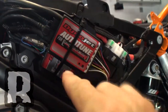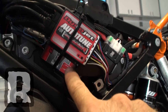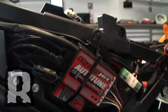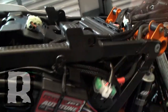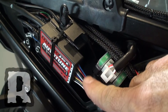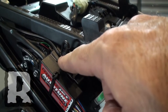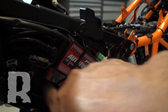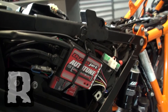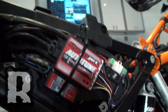I'm going to give you the basic layout. We've used 3M VHB double stick tape, and I put the auto-tune on top of the Power Commander 5 in this configuration — you basically match up these corners right here. When you do that, everything is accessible: you can get to the screws for the wideband O2 leads from the backside, you can get to the USB, and you can get to the inputs on the PC5. You can use double stick tape to put them together permanently and still access everything.